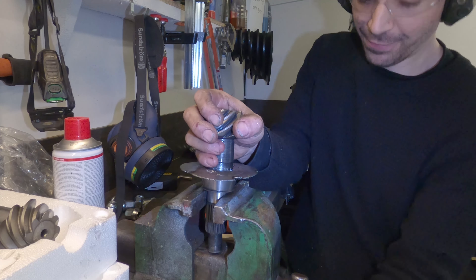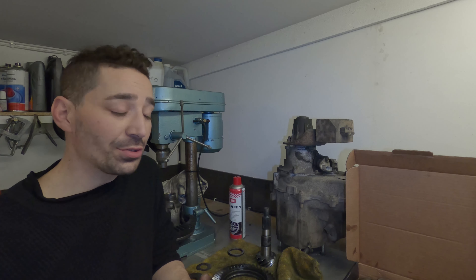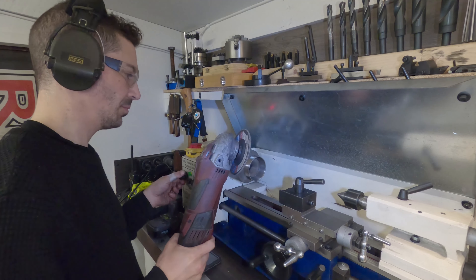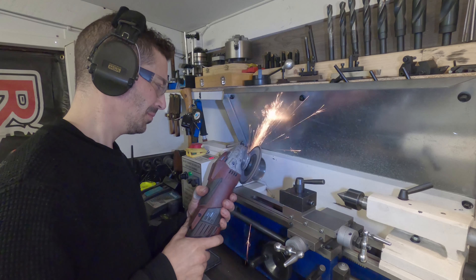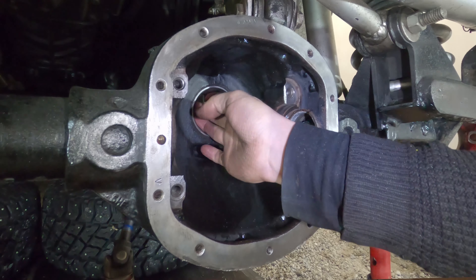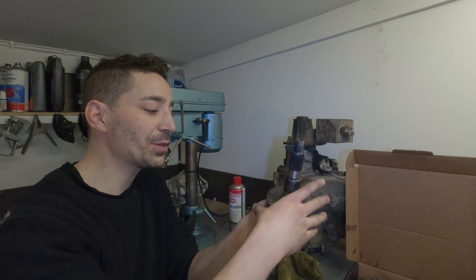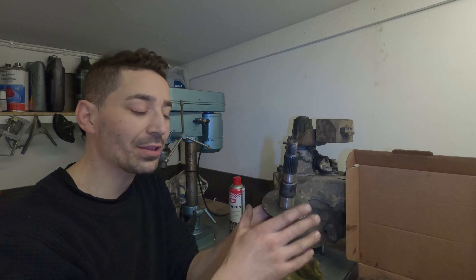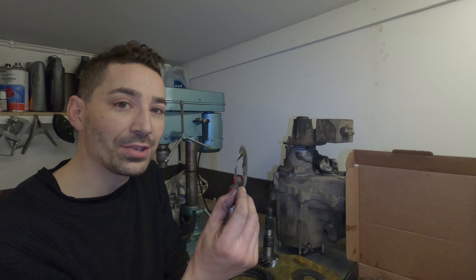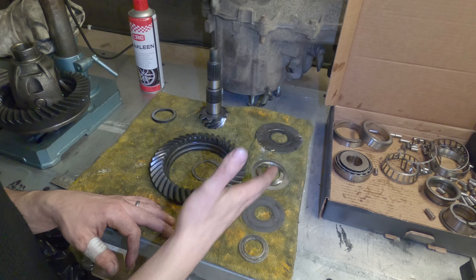It's been a fairly long morning of just preparation. I've also spent some time on the lathe just spinning one of the races on my setup bearing to make a setup race so I can get that in and out easily. With the Dana 30 High Pinion the shims for pinion depth go behind the inner race, and really all you have between the actual pinion and the bearing is a big oil slinger which makes up part of the shim stack. You don't necessarily need to put anything else between there — you can press the bearing on and make the rest up at the back of the race. Having a setup race is pretty important because you end up destroying one of the oil slingers just by taking that race out.